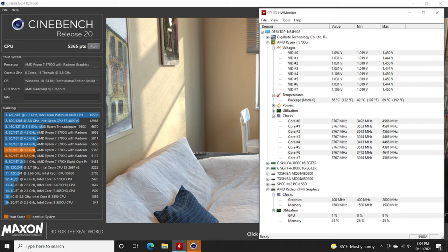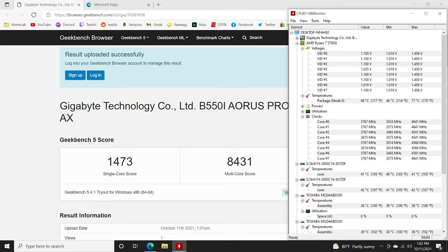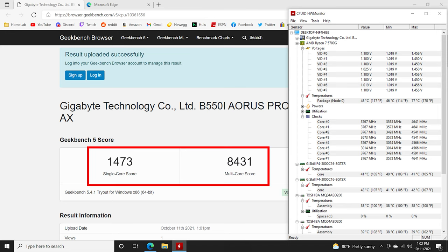So how did this perform in our tests? I ran a couple of different tests. The first was Cinebench — I only ran it once to see how it handles a short burst of heavy CPU usage. It did fine. The processor scored well within what I'd expect, it didn't throttle, and we got up to about 89 degrees. Yes, that's high and not what I'd consider comfortable, but when you're talking about an eight-core 16-thread CPU in a tiny case with a really small cooler, perfectly fine. Then I ran Geekbench — CPU scored as expected, no thermal throttling, and we were still in the mid-70s.